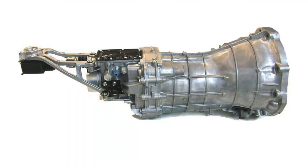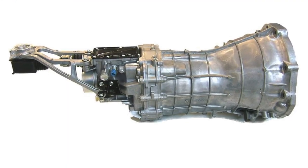There are a few other transmissions people go with, like the Nissan 350Z transmission, which is a 6-speed codenamed the CD009. That one is a little harder to swap in because you'll need to get a bell housing adapter and a few extra things to actually get it fitted into this car.